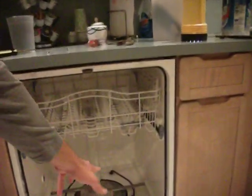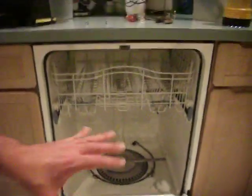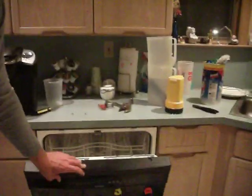Okay, this is a video on the repair of a Kenmore dishwasher that won't drain, the water won't go out. Now, just a quick overview, I made the first video. I pulled that up, the arms, and I checked underneath, and in my case, that was all clean. We cleaned the dishes before we put them in, so it's very unlikely that that would cause a clog. And even then, usually, it would drain slowly as opposed to just stop completely.